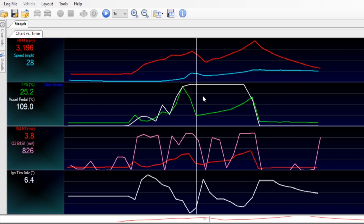That's why it feels like somebody is definitely taking over. And if you look at this white line, this is the ignition timing — it drops all the way down to basically zero timing. That is a tremendous reduction in power. This is exactly why traction control works so well, especially with electronic throttle control versus a cable. You can never do this with a cable.